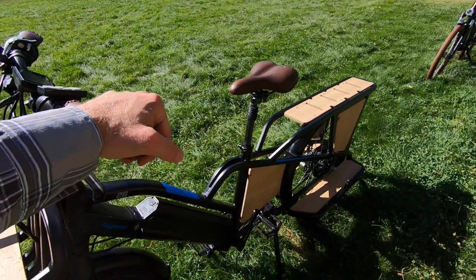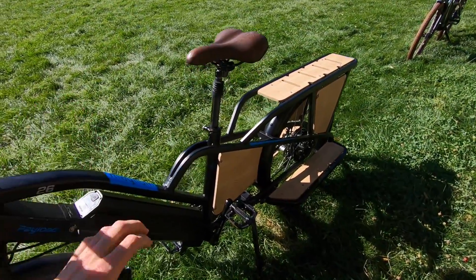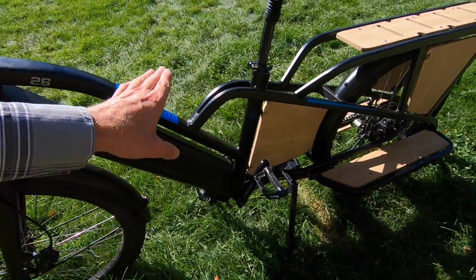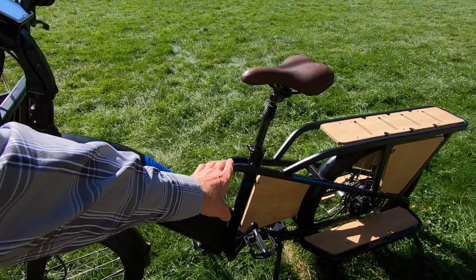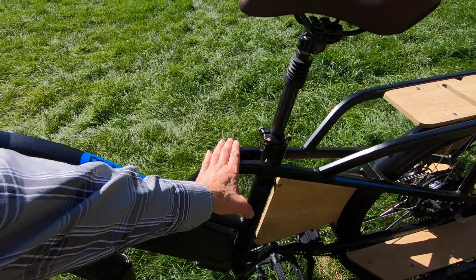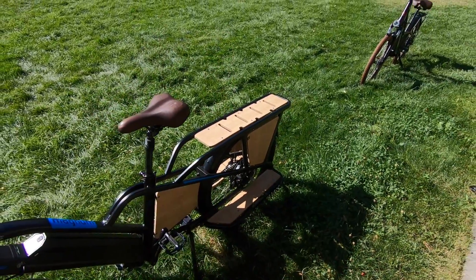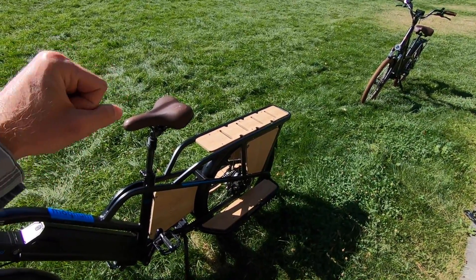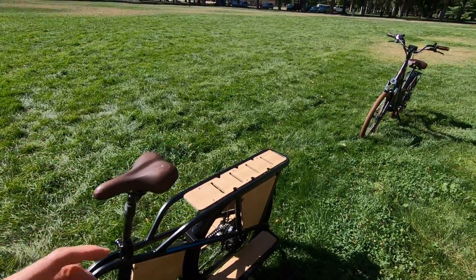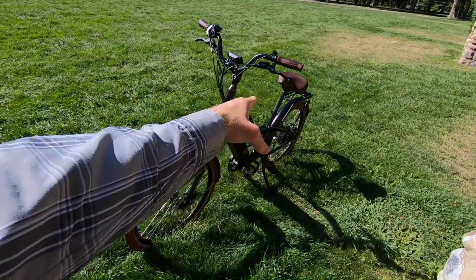There's a functional reason they put this extra tubing right here and why there are two tubes — this could have been a low step and a little bit more approachable had they not added these bars, but doing this reduces frame flex. Because you've got all this weight back here, including the motor — that's like an 11-pound motor — the whole frame can start to flex around a little bit, and that's not as stable or as comfortable. You'll notice this one also has a suspension fork, which adds a little bit of movement to the frame.